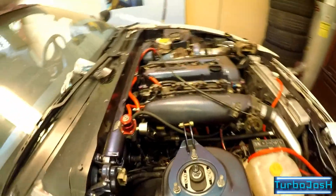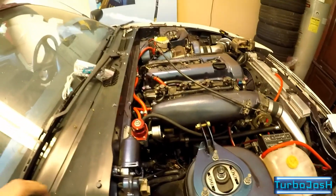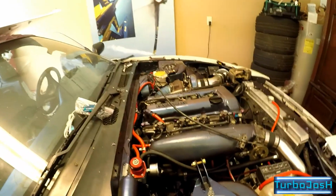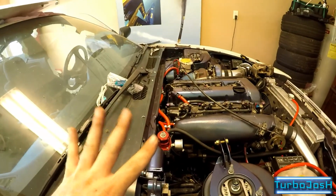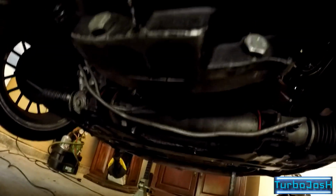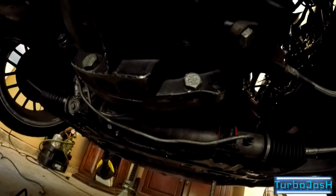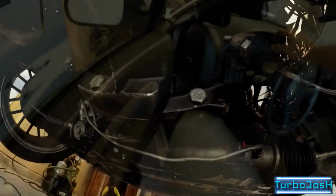There were no knocks. I'm about to take a look and see if there's a leak right now from just priming the motor, and then we'll start it. But I don't think there will be any leaks, since I pretty much made sure that we have enough RTV to solve the leaking problem once and for all, because I believe this is the third or fourth time the trans has gone back in since the rod bearing. I don't see any fluid, so we just ran it. I'm about to run it again for you. I don't see anything. Thank God.